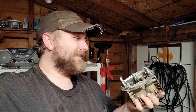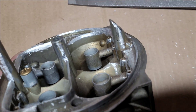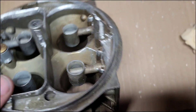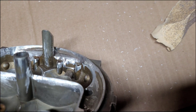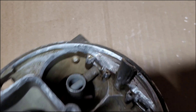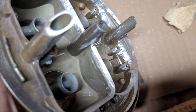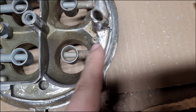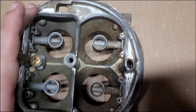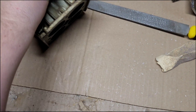Here's the finished product — check it out, it actually looks pretty good. You can see I went around and radiused the edges, and I actually came and radiused the air cleaner ring here too, and incorporated it down into the corner of that radius. I did the best I could back here. Could go further, but I think that's probably fine, especially since the hole's there — taking it way back isn't going to do too much. I think this is as far as we're going to go with the actual main body. We still got stuff to do with the base plate — radiusing the butterflies and throttle shaft and all that.